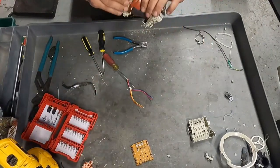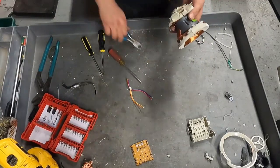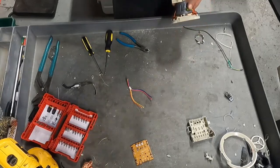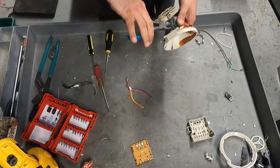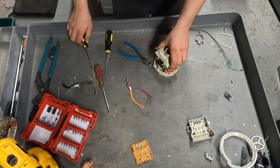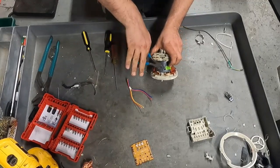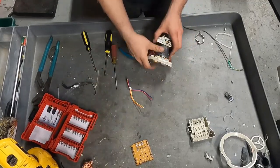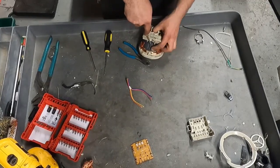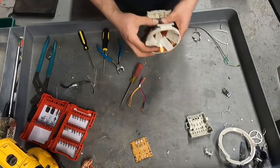Okay. Normally what I do on these, there's 2 clips that hold it in place here and here. I don't do a flat blade under it. The reason being is these are under so much spring tension. When you get under here and pry up, it's gonna fly everywhere. So I usually take a pair of vice grips here. And you know what's gonna be funny? These aren't the grips that I usually use. I am lying. All right, here's what we're gonna do first. We're gonna hold our finger over it, pry it a little bit, and then grab it. There you go. Now you don't have to worry about it flying everywhere. Just keep your finger over it while you're getting the blade underneath it. Once you get it, there we go. Done. Don't have to worry about it hitting you now.